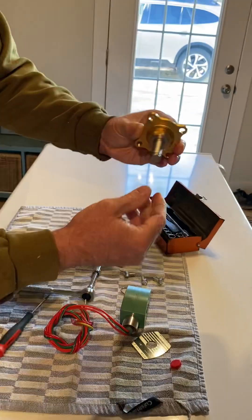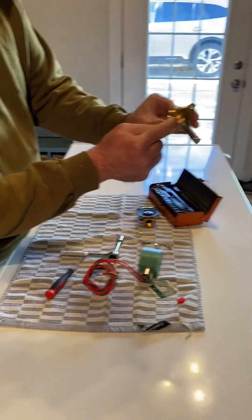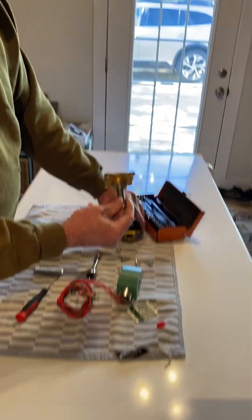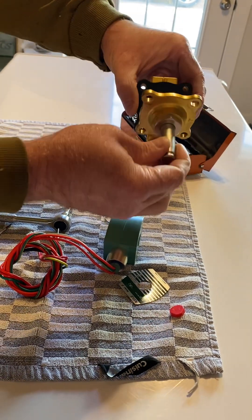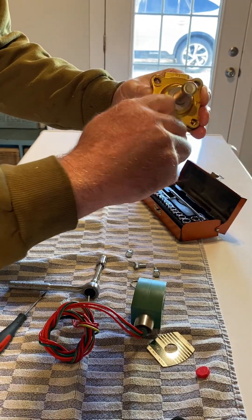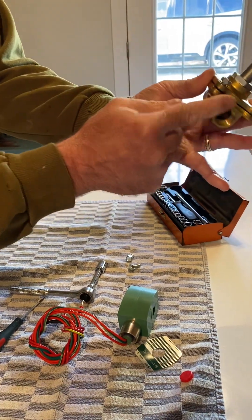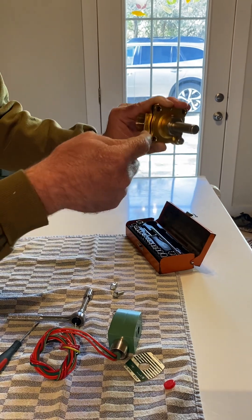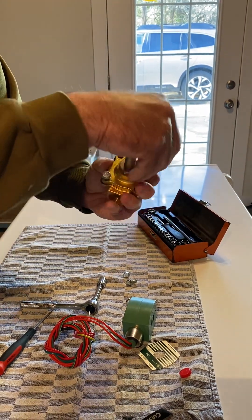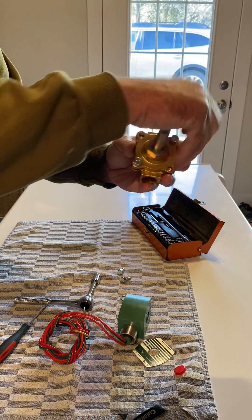This little piston and the spring will come with the kit. If I had a one-inch socket I'd show you — you can break this apart counterclockwise, and there's actually an o-ring in here that's replaceable as well. That o-ring between the solenoid and the brass housing also comes with the kit. We're going to put this back together, close it up, line everything up, and get the bolts started hand-tight. Make sure the o-ring doesn't pop out of its groove and that the rubber gasket stays in place.